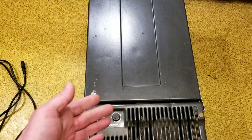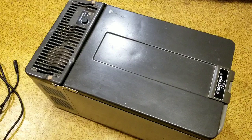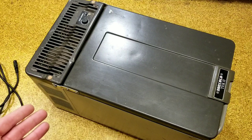The fact that it's really efficient, that it can be rocked around at many different angles, and once again just being able to handle repeated power cycles — this is pretty much the best refrigerator slash freezer that you can get in this form factor. I wholeheartedly believe it. These Norcolds and the Engels, some people may be familiar with these, and they really do work as advertised as long as you have ventilation on the back half. And even though they're heavy, you're getting a real refrigerant compressor — a very special, tremendously reliable compressor. Since it only has that one moving part, that resonating piston, the compressor effectively lasts forever.